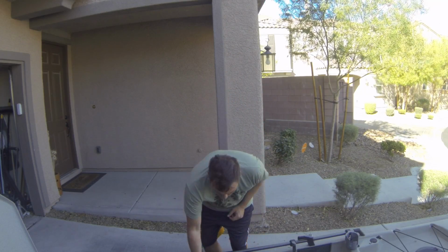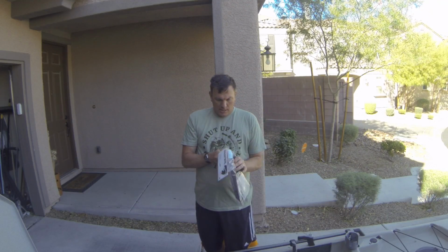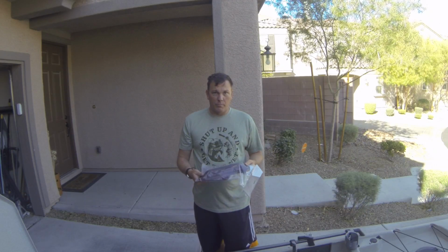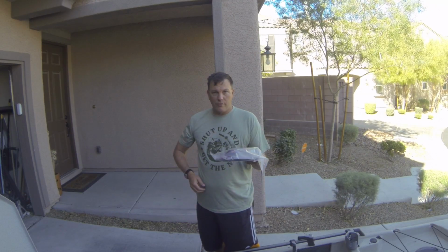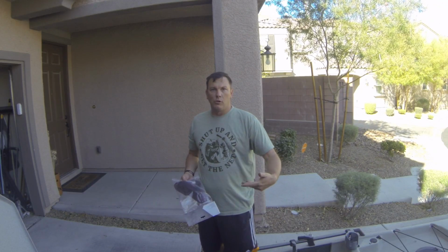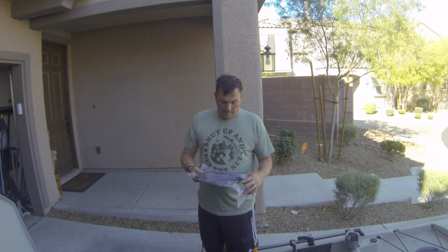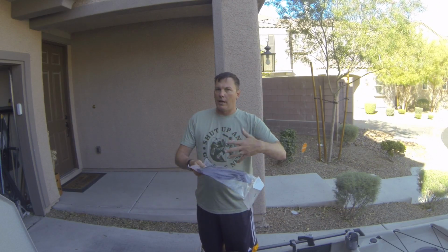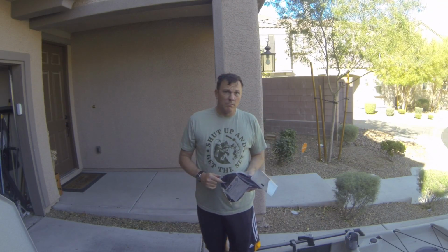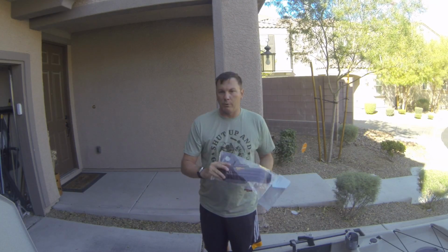And the cool part is I found this company called Berley Pro out of Australia, and they make an adapter that's best suited for the Pro Angler that allows you to put the total scan transducer down below the bottom of the hull using the Lowrance ready spot on the Pro Angler. And because it's down below the hull now, you've got your full side imaging. So this video will be going over the uninstall of the old system and the install of the new system using the Berley Pro.